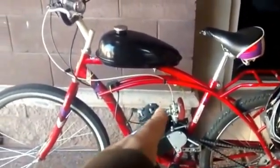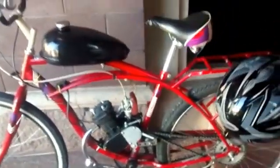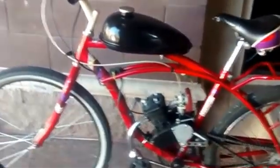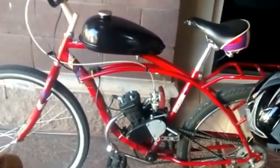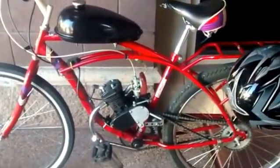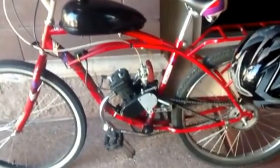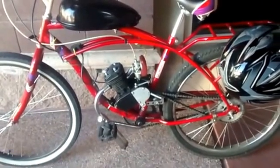I'm going to leave it set and run back this afternoon, because the air is pretty dense — it was cool out, 59 degrees when I went by the temperature gauge at around 9 o'clock. That has a bearing on it too, the cool and the density of the air running on the top lean. But we're going to run it back this afternoon in the heat — it's supposed to be around 74 degrees — so let's see how it runs in warmer air on the way back. The hill — it didn't want to climb the hill at all, just not getting enough fuel at the top. It just bogs down and I had to actually pedal. I'll catch up to you on the way back.